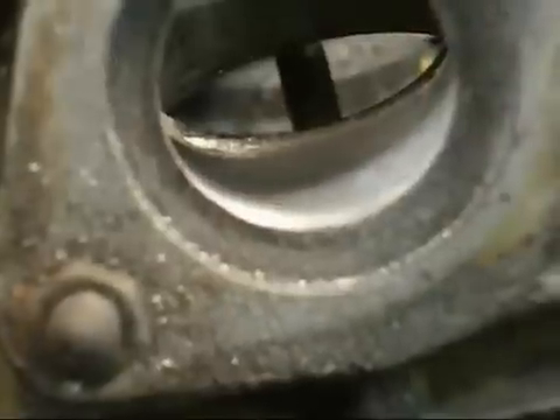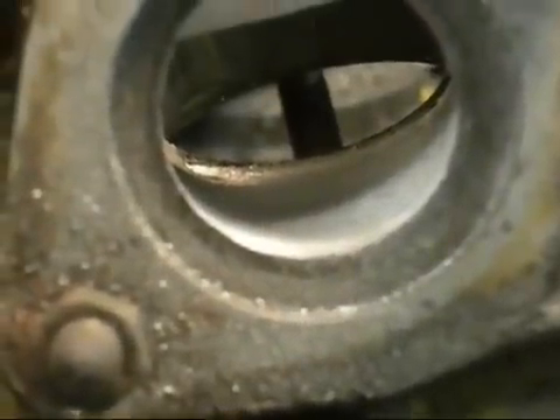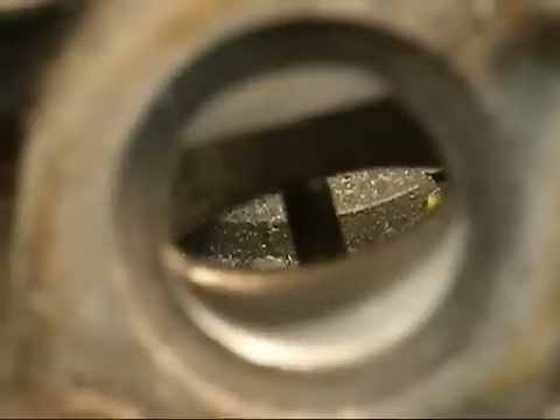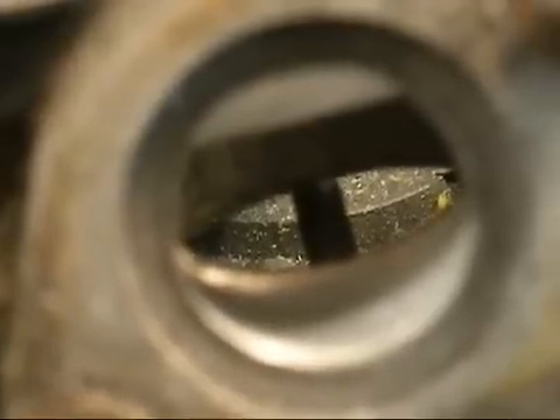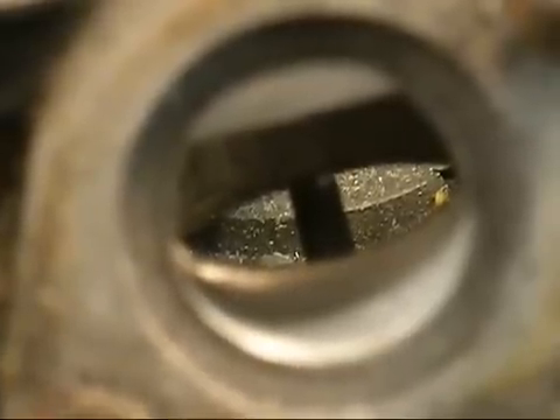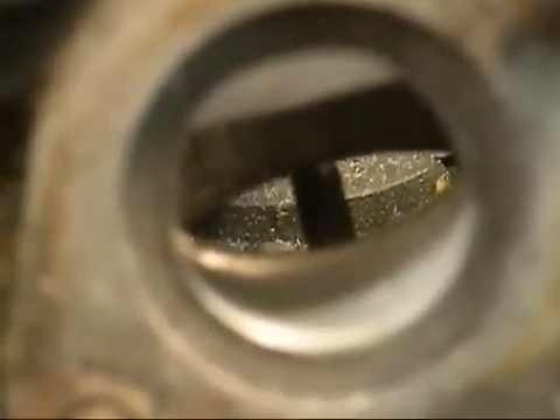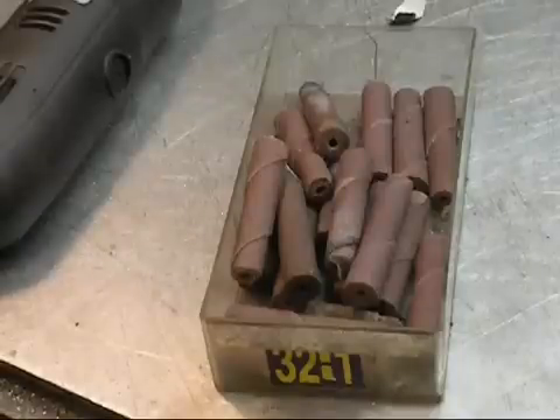You can see it is still a little rough on the exhaust. My theory is you should be able to see yourself in this stuff when you get done - want it to be very shiny. That is going to make it almost impossible for the carbon to stick to it. Air flow will definitely improve. But we want this surface to be as smooth as possible. We got our cylinder bluestoned out - we did our carbide, then the bluestone.